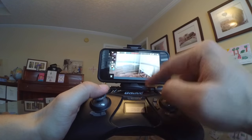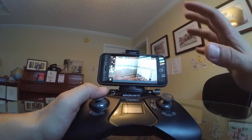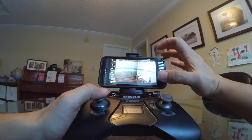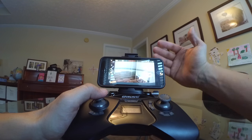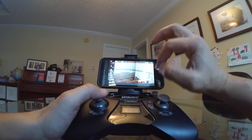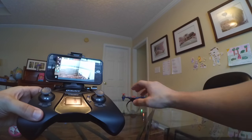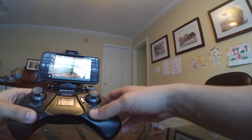I'm going to turn on the transmitter. The transmitter binds to the quadcopter with a different signal and a different mechanism. So you can bind the phone first like I did, make sure it's hooked up to your Wi-Fi, open the app, and then link the transmitter to the quadcopter. That way you'll be good to go.